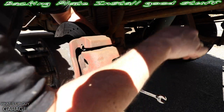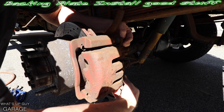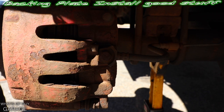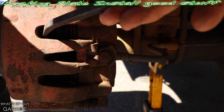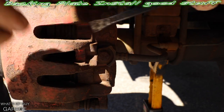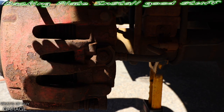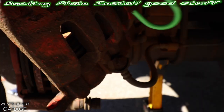Use a 13-millimeter wrench to take off your caliper bracket or slide bolts — got two of them on the backside. Don't let the red confuse you; this is just a Power Stop caliper, literally the same exact thing. Kind of give it a pry — that's what these slots are for. Take a pry bar, catch the edge of the rotor, and you can kind of pry the caliper a little bit just to open it up, as long as it's not frozen like this one is. Then use that same pry bar and pry off the calipers.